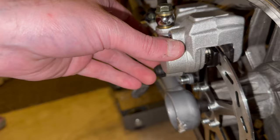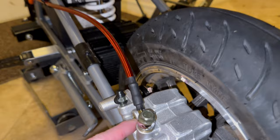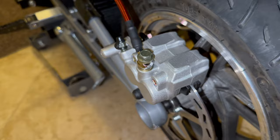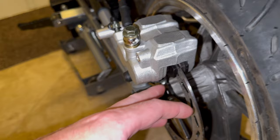In doing so, this piston retracted into the caliper reservoir, so my pads were wide apart - they were never squished together. I hooked up the brake line the same way with the two seals on either side, filled up the oil, bled it. I still was not getting any grab or pressure, but it showed as filled. I loosened this, saw oil leaking out, then retightened.